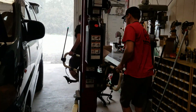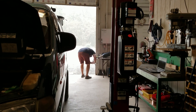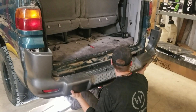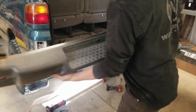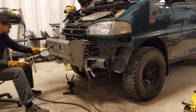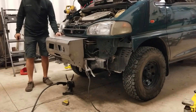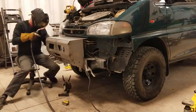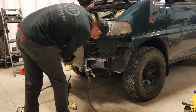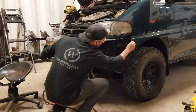Here we are at Wanderlust Overland in Oregon City. First step is taking off the front grille guard and then the front bumper. We're going to take the rear off as well and set that aside because there are parts we'll need for the rear bumper. Jake is assembling the center section of the bumper — all these parts come flat packed. These are 3/16-inch CNC laser-cut pieces. It's a bit like a super heavy-duty Ikea kit: a bunch of pieces that come together, and you tack them together to get a mock-up.